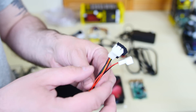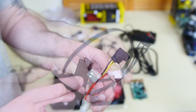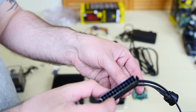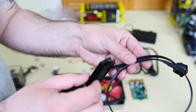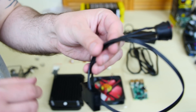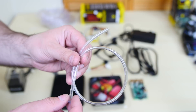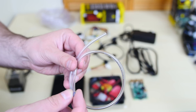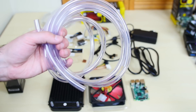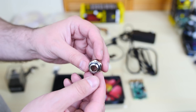This adapter is going to allow us to turn Molex into a 3-pin. The 3-pin will allow us to power up our res pump combo and also power up our fan. This connector is going to allow us to power on our power supply — it's got a power on and off. This is a 24-pin connector that's going to allow us to power on our 20-pin power supply. All we have to do is plug in our 20-pin power supply, switch on the power, and it'll turn on and off. This is the soft tubing that's going to connect all our water blocks and connect to our adapter. This is a 3mm inner, 5mm outer tube — the perfect size for our Raspberry Pi water blocks. I also got plenty of this other soft tubing for our other fittings.